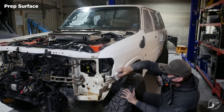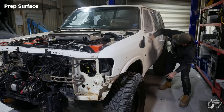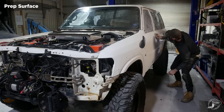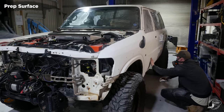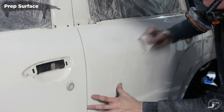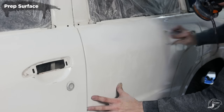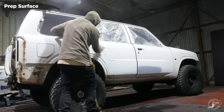As you can see here, I'm prepping the surface for the application of the paint. You don't want any shiny spots — that is the biggest thing with Raptor Liner. It needs a good abrasive surface to stick to, so you need to rough it up with at least 140 grit sandpaper; 140 to 240 is fine to get started. You can get flexible sanding pads from U-POL Raptor Liner that make this super easy for hard-to-reach areas.